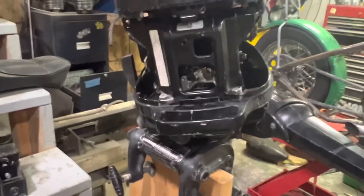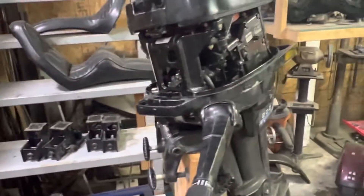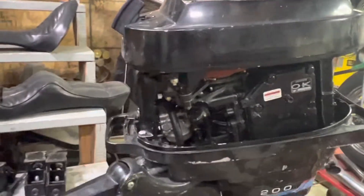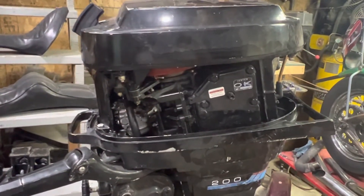So I did some quick checks — I just pulled the plugs, checked it, it's got a nice strong spark. Feels like it's got okay compression, I didn't put a compression tester on it. But just to get us started, we're going to try and figure out if I can get this carb off. I'm pretty sure it's not running, but I think it's just a carb issue. Spark and compression are there, so let's get set up.